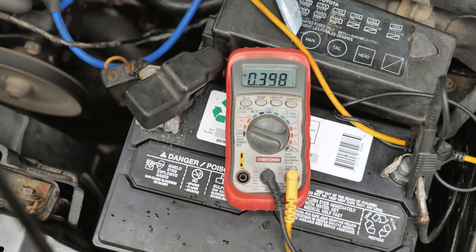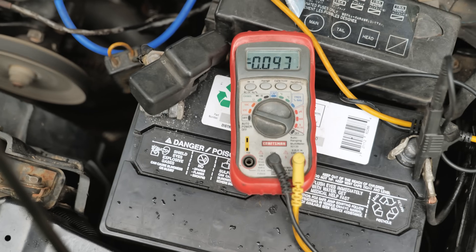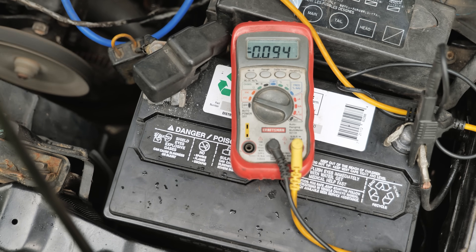See how it went to 0.6 — 0.6 is not enough, it should have gone to 0.8 on that. The sensor has to be hot to work. I just don't believe the numbers I'm seeing from this sensor.